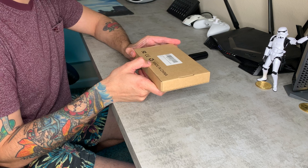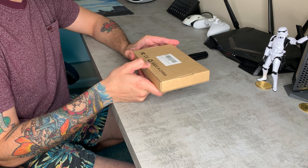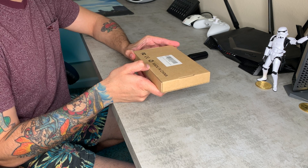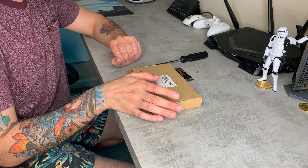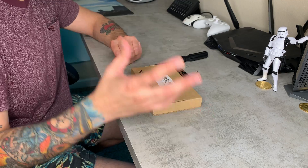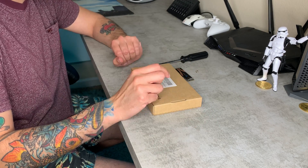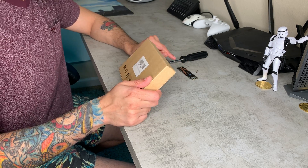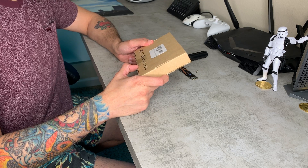The Alienware R10 and R11 motherboard only supports one NVMe. So if you bought your R11 like I did with an NVMe SSD but then you have a second one you want to pop in, or you want to upgrade but don't want to reinstall Windows since your boot drive is the NVMe SSD, the only way to do that is with an adapter. The NVMe SSD as well as this adapter are linked in the description below.